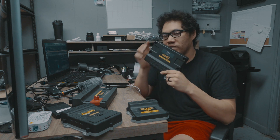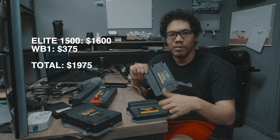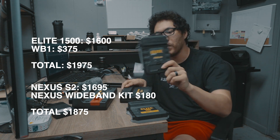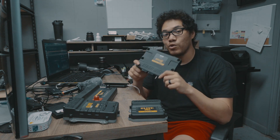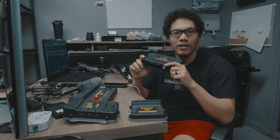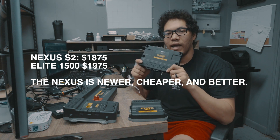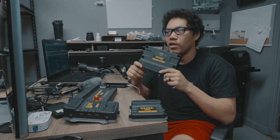In my opinion, if you can swing a little more money, jump from the 750 to the S2. Why the S2 over the Elite 1500? The Elite 1500 retails around $1,600–$1,700, and you also need to buy a wideband — most people opt for the Haltech CAN wideband, the WB1, which retails for $375. So the ECU plus the wideband costs the same amount as the S2, which has an integrated wideband controller built in. You simply plug the sensor into the ECU without buying an extra box. When all said and done, they're the same price or within about $100–$200 of each other.